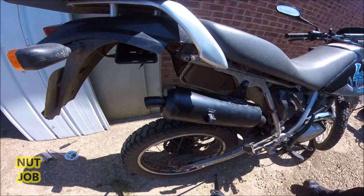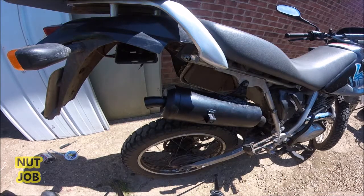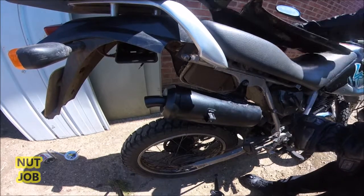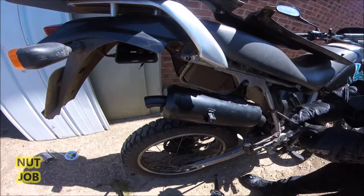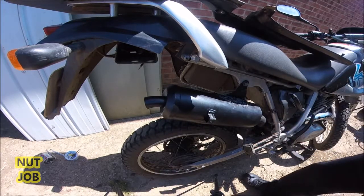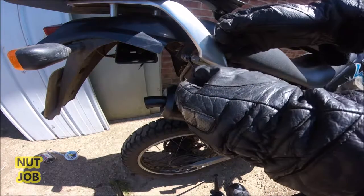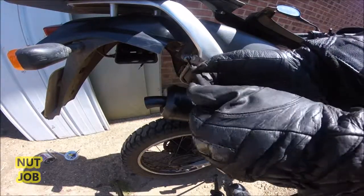Now the back pressure test, which I did down here. I just grab a screwdriver because I've got the pot panel on. Back pressure test. Yes, it was less than 1 psi, so that's why I didn't do much to the silencer. Less than 1 psi. And I just basically left it as is. Now, when I revved it, it went above that 1 psi, so it's probably all right. Won't cause much of a problem. So, yeah. Not too much of a difficulty. So, I'm going to leave it as is.